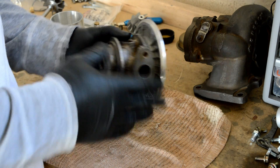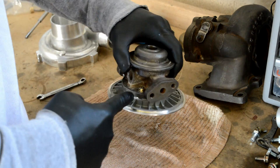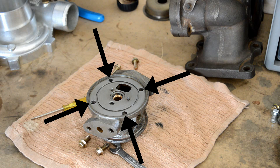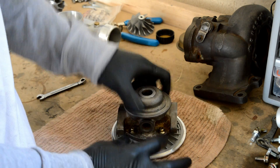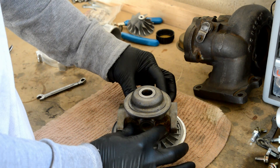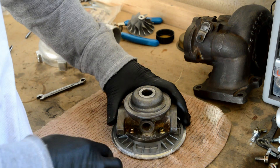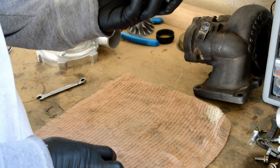Fitting that back plate onto the center housing — what I ended up having to do is with my Dremel, slot the holes a little bit inboard, because surprisingly, even though this is a bigger back plate, the bolt pattern here is actually a little bit smaller. But it wasn't that big a deal — just took the Dremel, gave it a little bit extra room, good as new.